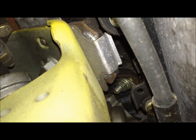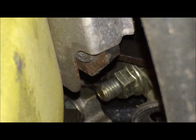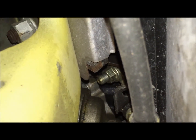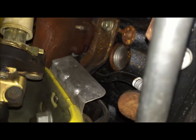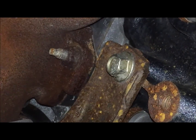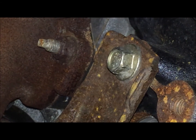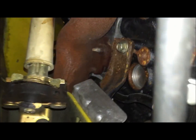I'm under the car on the driver's side looking at the motor mount and where the ground attaches. There's a bolt here that's kind of inaccessible — that's where one of the ground wires attaches. But if you follow the motor mount back to where it attaches on the back side, it's much more accessible. That's actually where I'm going to run one of my ground wires for the Big Three kit.